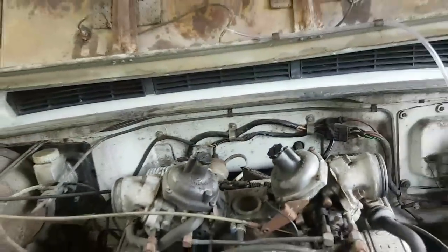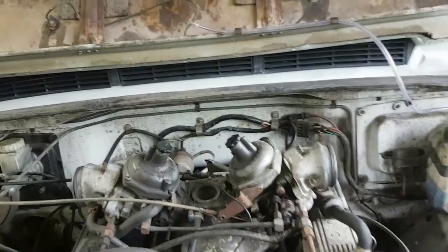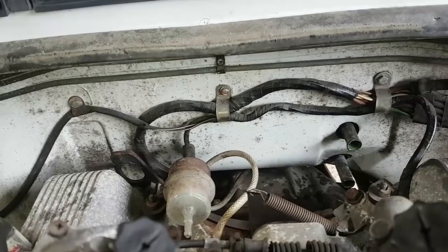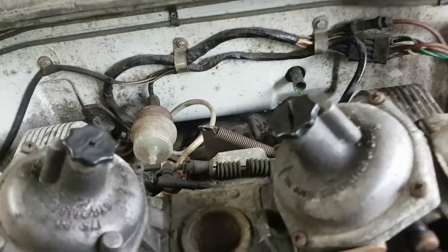Wrong pipe. So that's almost certainly why the diff lock wasn't locking. Wasn't engaging. That's pretty poor, actually. You think of all the other attention to detail that's gone into this car, and all of the 55,000 zip ties where you could actually get away with two, probably. And they go and put the wrong pipe on a vacuum line. Yes, okay, well, we could sort that out. That's not too much of a problem.